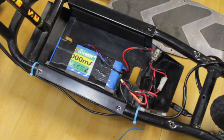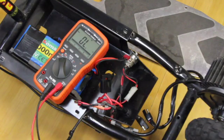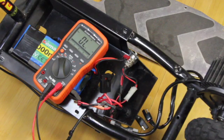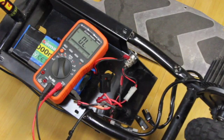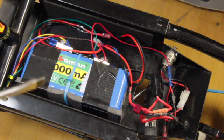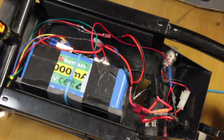Let me yank the motor out and we'll do some bench testing. I checked the wiring harness to make sure we had continuity all the way through — to make sure we didn't fry any of the wires — and the entire wiring harness from the motor to the battery is good. So all indications point to the controller. After taking everything apart and bench testing the motor, everything seemed to work fine, so we put everything back together.